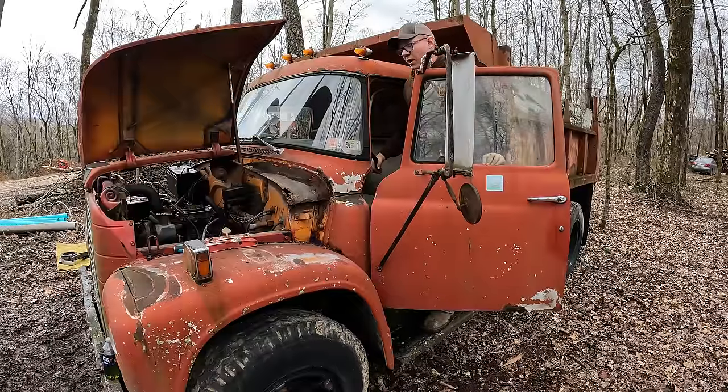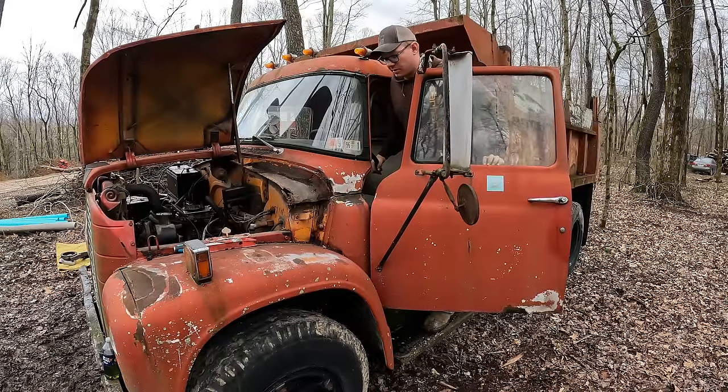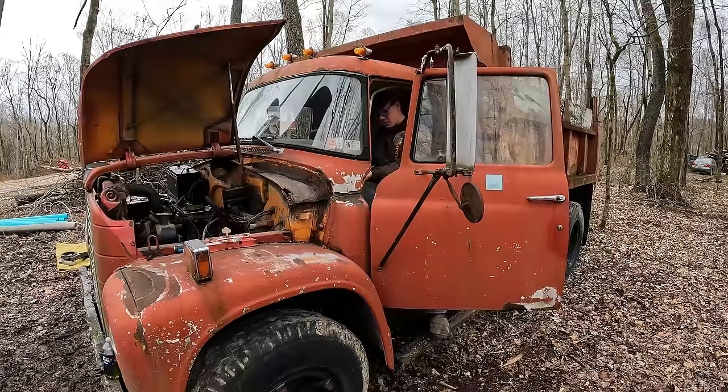All right, now the odds of this thing running smoothly are very, very slim. I just threw the fuel needles at two turns out on both of them, and the float levels both need adjusted yet, so just getting this thing to start at all is going to be a step. Guys ready? Contact!